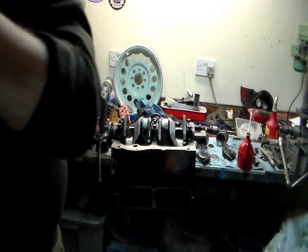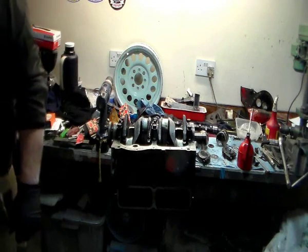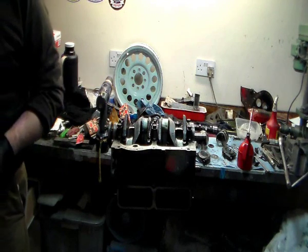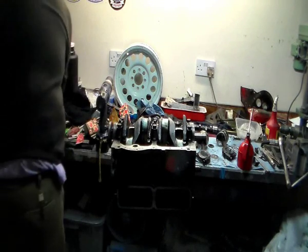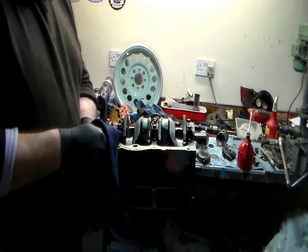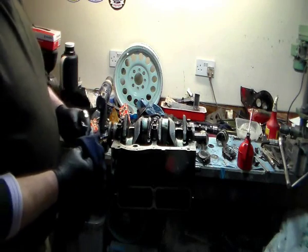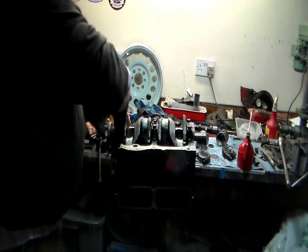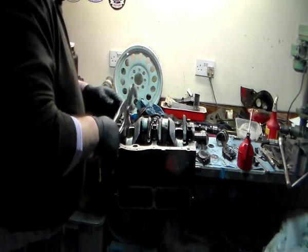And the last thing, sorry, in regards to the tab washers, I was whinging so much about the tab washers. I like to, if I can, use something like gooseneck pliers to fold the tabs around, rather than hammering them round or screwdriving them, because you can put more pressure further down and round, and it sort of locks better. So that's how I like to do it. Other people will have their own way, I'm sure.